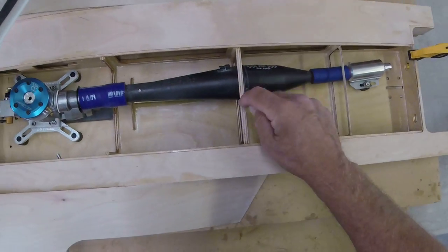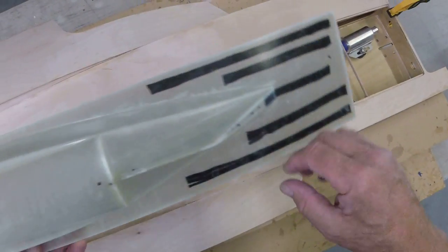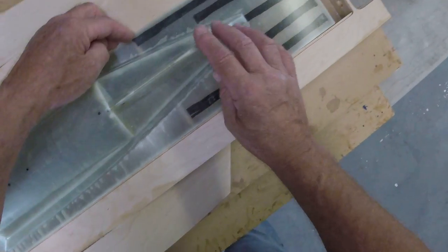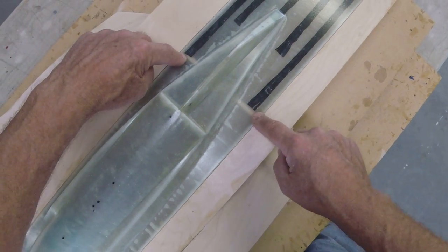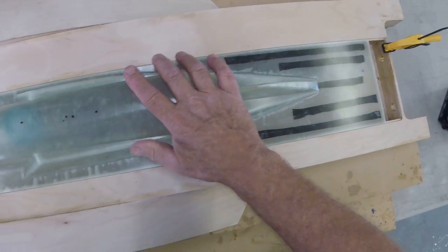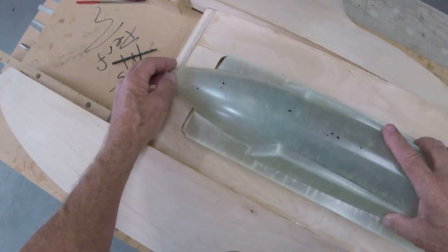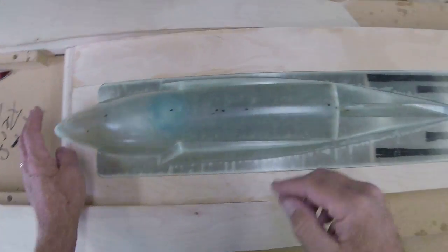This area will get cut out. I'll show you how we build a couple little platforms here, and we set a couple of matching magnets on a little bit of structure that we'll add here. And when you bring this cowling on, it's going to rip right out of your hands and slap perfectly into place. So when you're in a hurry, you put this thing on there, bam, it jumps on there all on its own, and away you go.